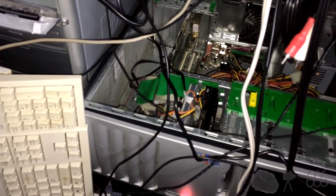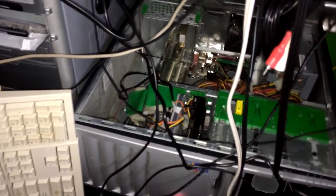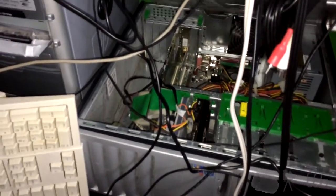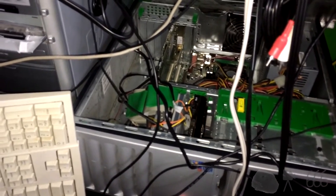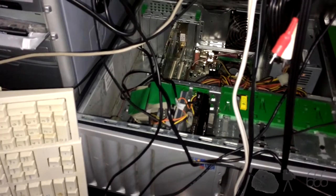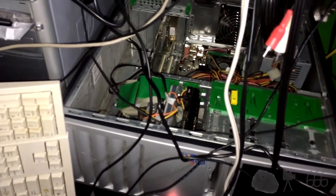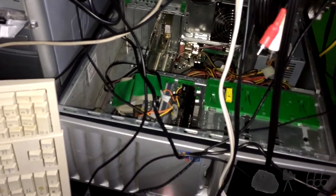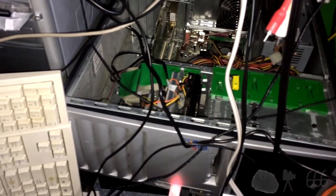Although, I don't know if I'd say the drive has actually failed per se — it's just got a couple of bad sectors on it, and hopefully a trip to Spinrite will get that all fixed. That's certainly possible, although that drive predates SMART data and it predates having spare sectors, I believe. So probably not. Bad spots are probably bad spots forever — they'll just have to be marked off and ignored by the operating system.